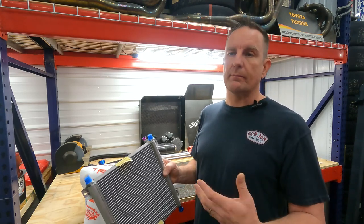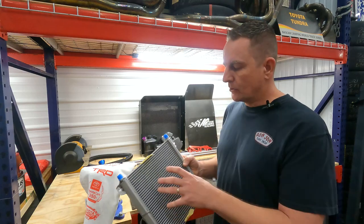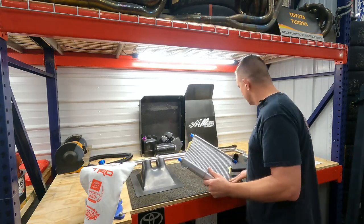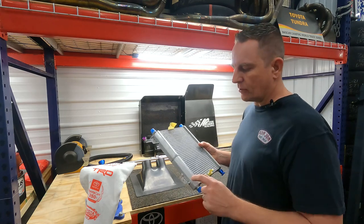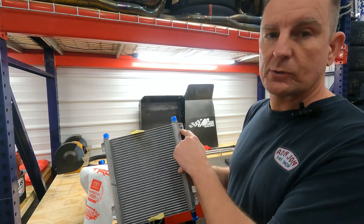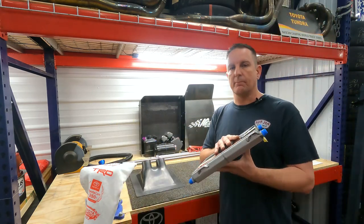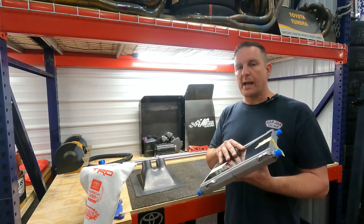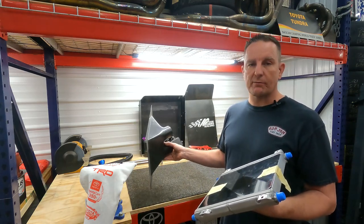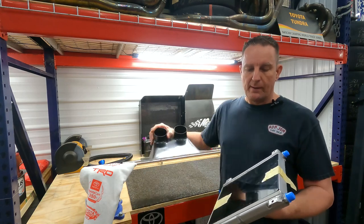It adds more weight, and it's kind of bulky and unsightly. So I'm going to go with this combination. The next thing that I do need to do with this is install some floating nut plates in the bottom tabs all the way around so I can mount this underneath the package tray. Once this is mounted underneath the package tray, I have to trim the carbon duct. I only have to take about 3/4 inch off the bottom of this particular ductwork.